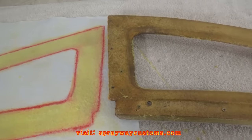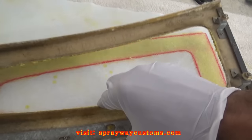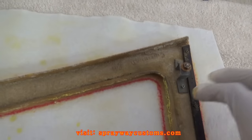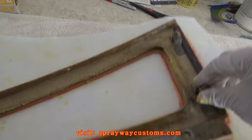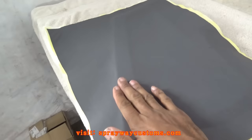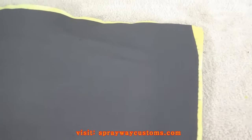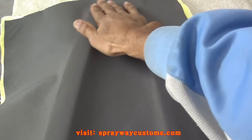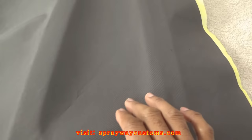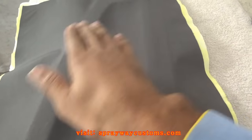Same process. The reason I'm using the back side of my hand is because I don't want glue there — the glue sticks to itself so it's gonna stick. You want to make sure both surfaces are dry, then go ahead and just lay this on top of it. You want to try to push a little bit of this canvas material up in here, because when you start trying to stretch it, it ain't gonna make this curve here. Canvas doesn't stretch like vinyl, so it's best to try to have a little give up in here before you start stretching it out tight.